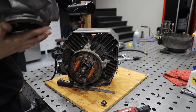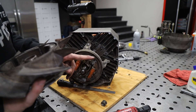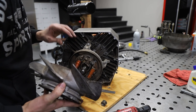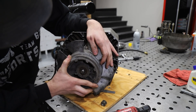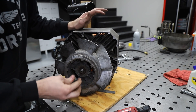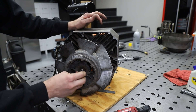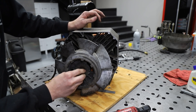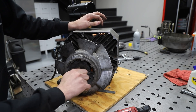Now that the magneto assembly's on - which is also pretty cool because this also has a generator for lights and for a battery, so we could run a headlight on this thing - we're now putting on the fan. One interesting thing is the threads on this are really messed up - they're chipped off, so it seems like the previous owner hammered on them. The problem is we can't get the nut to thread on, so we have to put this castle nut on backwards so it skips those first couple of threads. It's kind of weird and not ideal, but better than having the oil pump sticking out of the front of the engine.